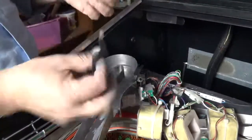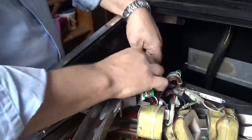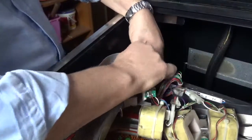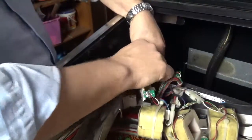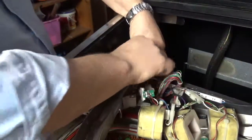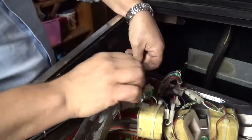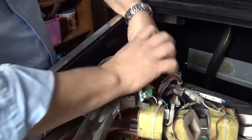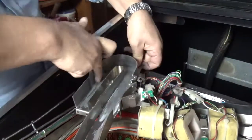So I'm doing the same here. I've got the 1200 grit sandpaper, a bit of Novus Number 3 as lubricant, and I'm keeping the direction the same to see if I can remove some of those track marks on the U-turn.